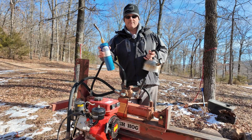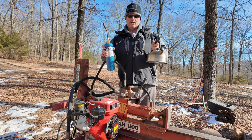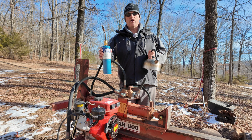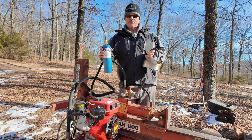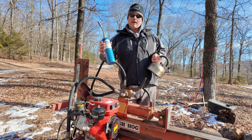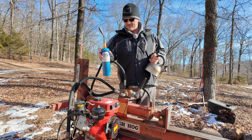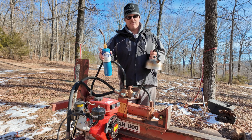As you can see between the two comparison videos, there is no doubt boiling water was the winner — it was a knockout. The propane put up a little fight and definitely got the job accomplished, but nowhere near as efficiently as the boiling water did. If I'm heading up into the woods and my engine is cold, I'm going to take a big thermos of boiling hot water to pour over the head. I'll probably still take a torch just in case I need a little extra heat. Both will get the job done, but I'm 100% in favor of boiling water if you have the ability.